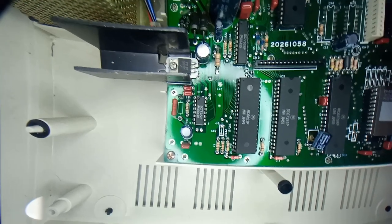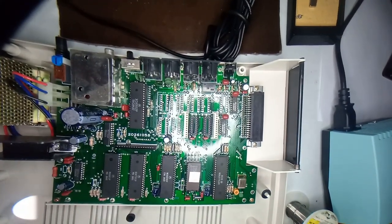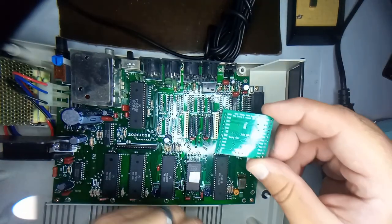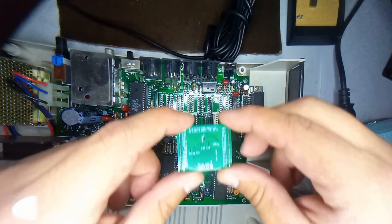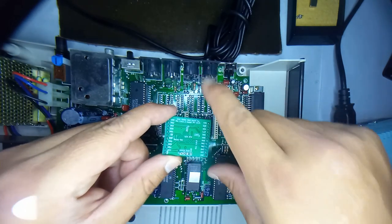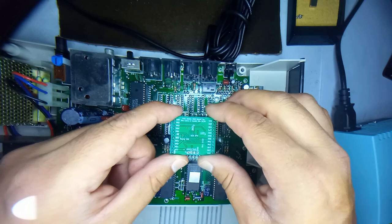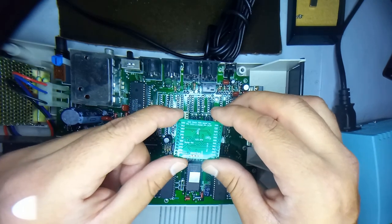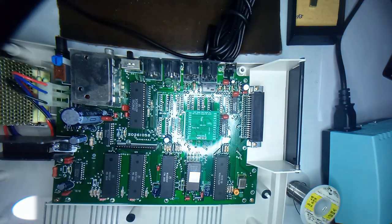The RAM I'm going to add is a RAM board that I made - it's actually static RAM, and the CoCo doesn't care. I have another video talking about this board. The silkscreen tells you how it's oriented: there's an arrow pointing to the back of the CoCo and another arrow that points towards cart. So if you install one of these, make sure you get the orientation correct. It should just be a matter of popping that into the expansion port - and that's it.